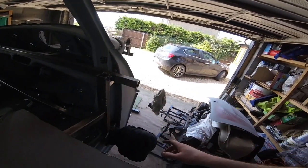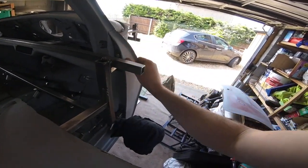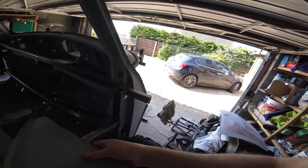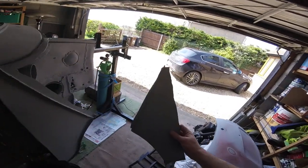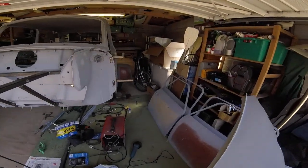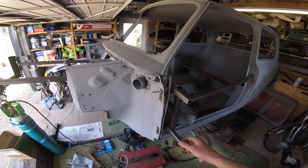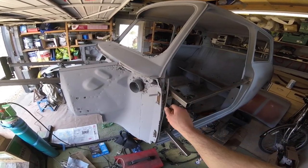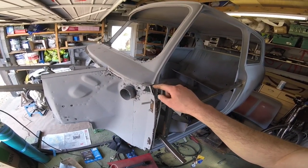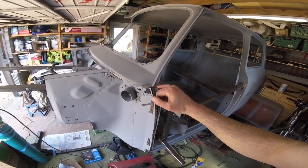But because I'm replacing the inner wings, we can just cut all the way down this line here and across here. So this is the one from the other side. I'll show you very quickly. So what we did was we made this cut down here and then a little cut across here, being careful to be below where the new A panel will finish.